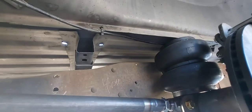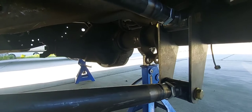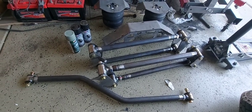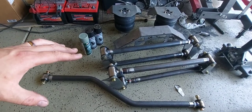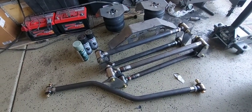For the bed, we're going to be doing a doghouse — should be pretty shallow, around four inches — and we're going to section the wheel tubs, push them in and out to the sides to get a little more wheel clearance for the bigger wheels in the back. Stay tuned for the welding of the axle and all that fun stuff. We'll give a final update on the four-link and the rotors in the next video. We'll get the C-notch done, notch the frame, run the suspension through all its travel, make sure everything clears, and start final welding. It's hot guys, so I'm going to go take a shower and a cold drink — catch you on the next one.